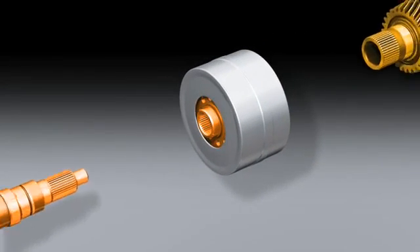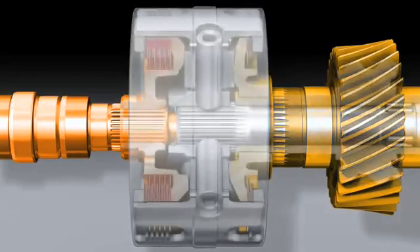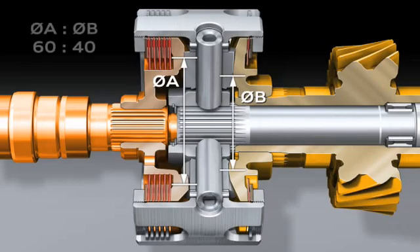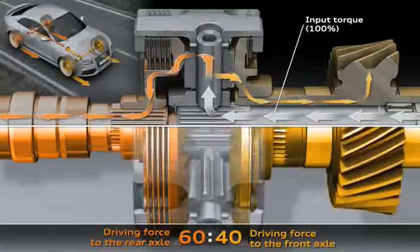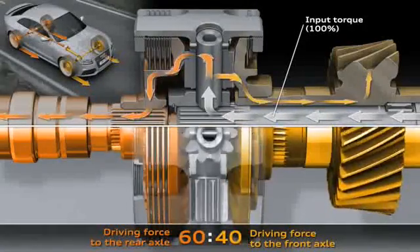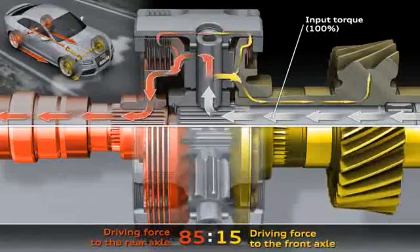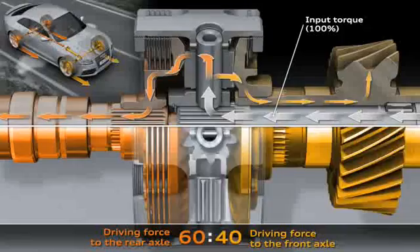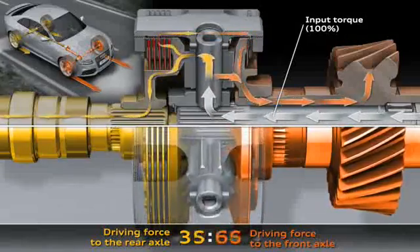The new crown gear employs a metal cap to keep flow losses to a minimum. The basic distribution is generated by gears with different diameters meshing with the two crown gears. The arrows symbolize the flow of torque or force. If the wheels on one of the drive axles are unable to transmit the full force, the center differential and its differential gears will spring into action. The force will immediately be fed to the axle with the better traction, with zero time lag.